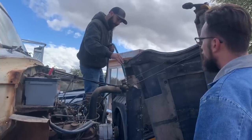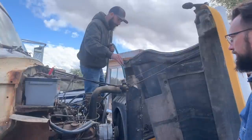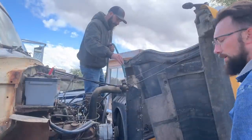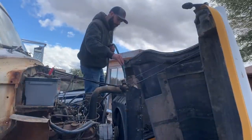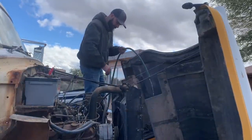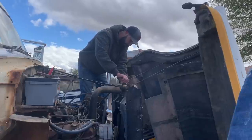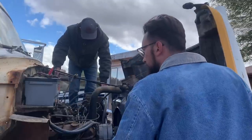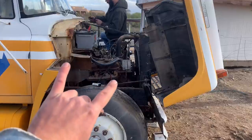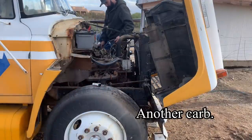You see it in the tank? Yeah, it's starting to fill up the neck. A lot of bubbles. Okay, now it's filling up. Shut it off. Put that on for now, I guess. Well, we'll probably find that leak. We have another carburetor we're going to swap out with it, just to get it running today, and we're going to rebuild the one that was on it.